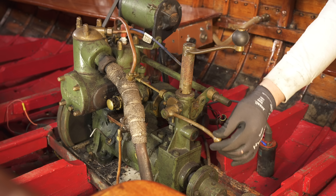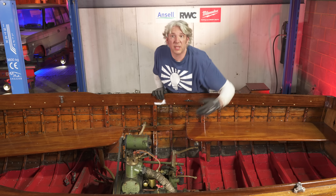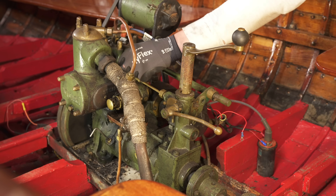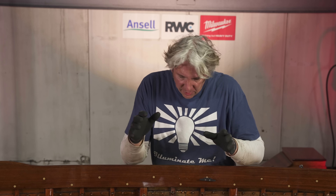Just below on the same mechanism, there's this little lever — that's for the throttle, so it controls how fast or slow the engine spins and therefore how fast or slow you go. Following this little shaft towards the engine, there's a little cam on the end, and that's actually just to help open the throttle up a little bit to help with starting, a little bit like a choke. So it is a very, very simple engine, which is quite wonderful, but I've still got to get it to start.